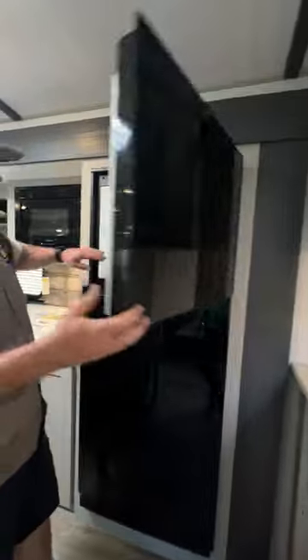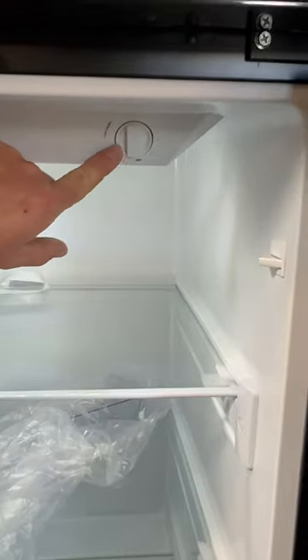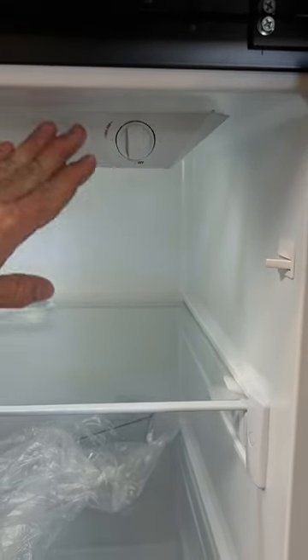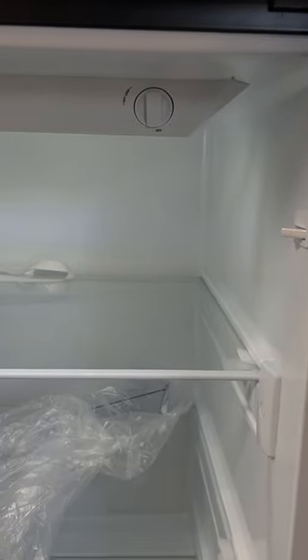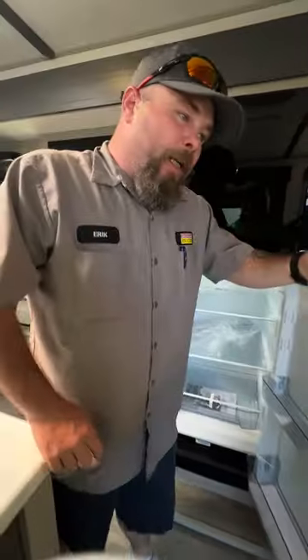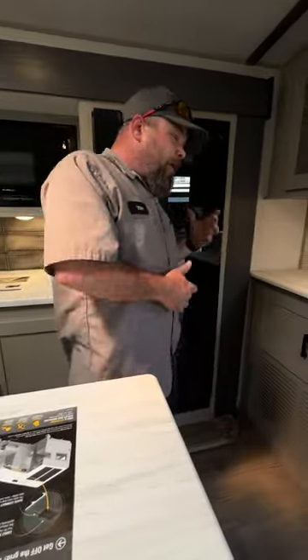Next, we're going to have our fridge. You've got your freezer up top. This looks like it is a 12-volt style fridge. You've got your settings up here, and it does have an off-grid mode — that feature is designed so it's not trying to pull as much power from the battery, so the solar power should help keep up. Just know that when it's summertime near 100 degrees, a lot of fridges are going to struggle — same with air conditioners. Most air conditioners are designed to only put out a 20-degree difference from what's outside, so if it's 100 degrees outside and your camper is hitting 79, it is doing good.